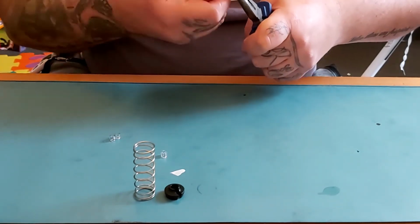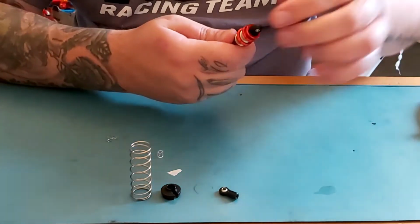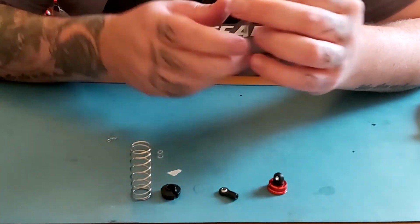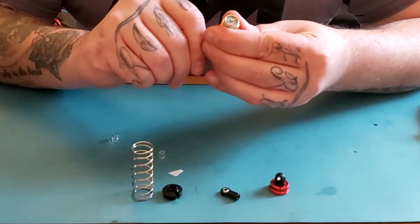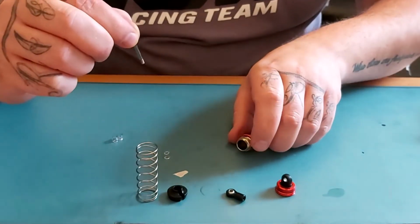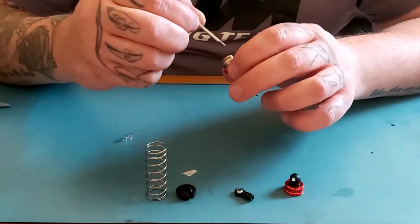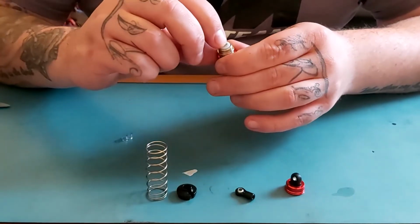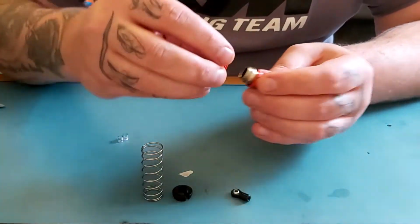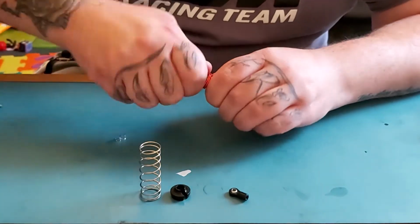Somebody tell me in the description what these are actually called, because I don't know. Don't just call them end caps. We then remove the top of the suspension. And there's no oil in this one because I removed it earlier on. So we pop the piston and shaft out again. Place the tubing on and reinsert. Make sure that the pin's in. Pull it down. We'd fill with oil, or if you want to run them dry, then that's entirely your choice.